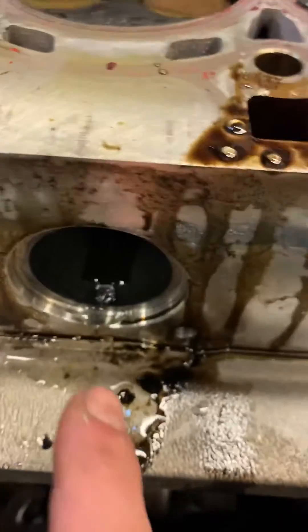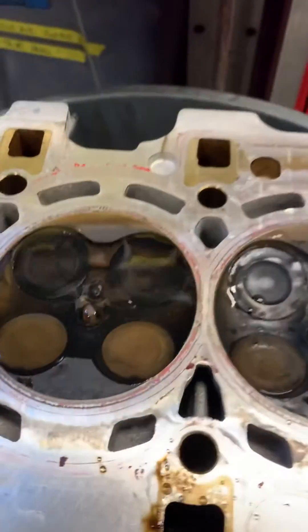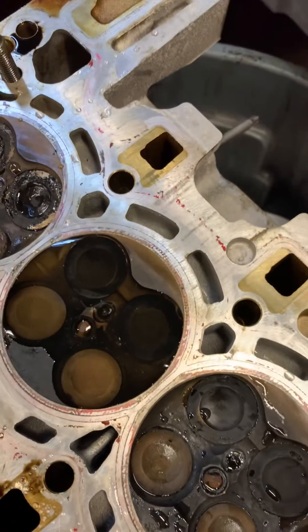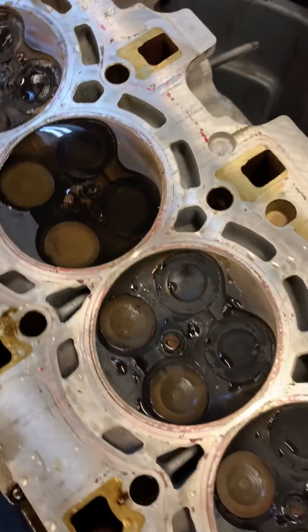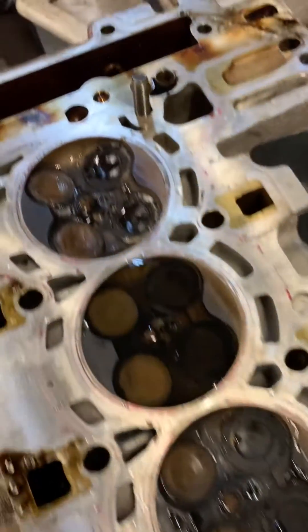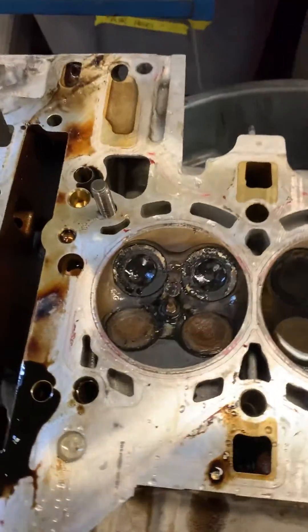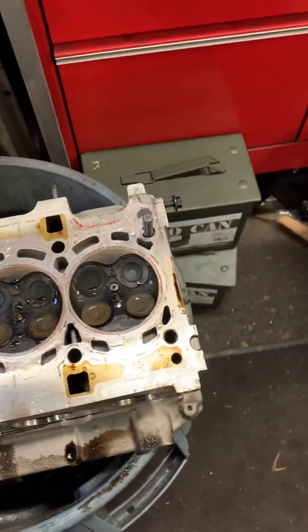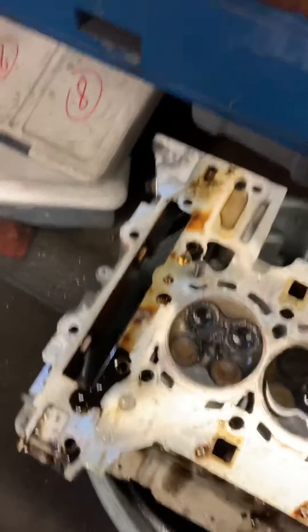There's obviously a little bit of water leakage coming out through there, but that could just be dirt on the valve seal seat — simply running the engine will bring it back up. When we ran a leak-down test it looked bad, but we're not sure if it was an error. Nonetheless, we're going to clean this engine and put it back together. I'm going to assume it's a non-interference engine and we should be fine.